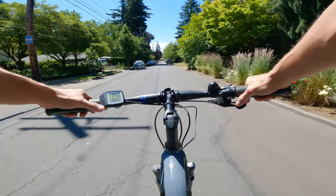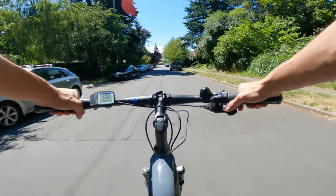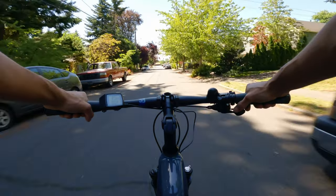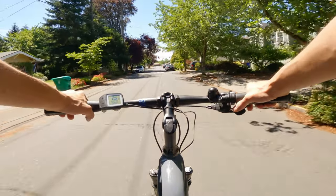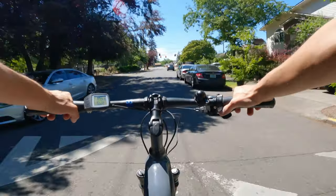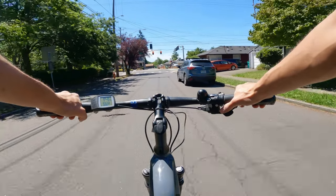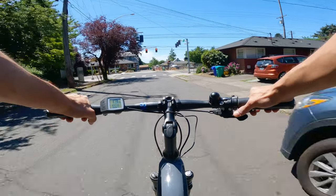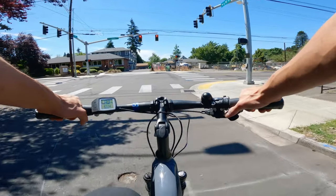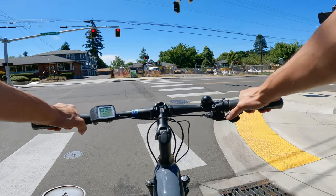Let's put us in eco mode — that gets us a little more power for sure. This has a torque sensor, so if you are soft pedaling the motor isn't really going to kick on. You want to make sure you're in a good enough gear that you can put some power down to get some use out of that motor. That's nice to have because it can be a little more efficient — you're not just having your motor on or off.